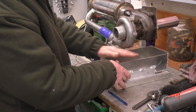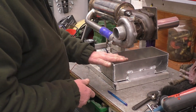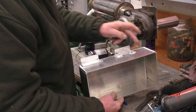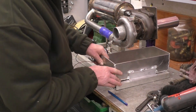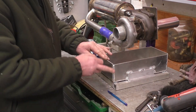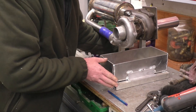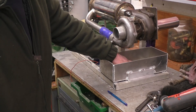That's the base of the oil tank done. I've got to make a top for it and I'll probably make an aluminium screw-on filler plug to go in there. There's a tube to go in here which is the oil out, and oil return from the pressure relief valve goes in there somewhere. Basically it fits in there quite neatly — as I was doing it my TIG welding was starting to get better. I haven't welded aluminium for quite some time; it's something you've got to keep practicing, but it's not too bad. I've had water in it and it doesn't leak.